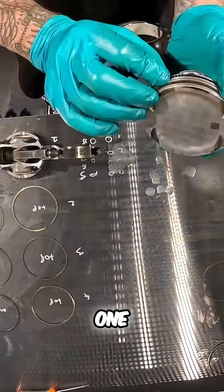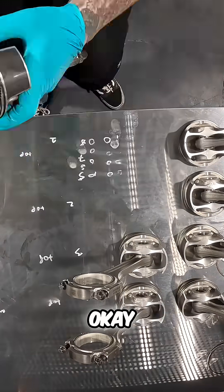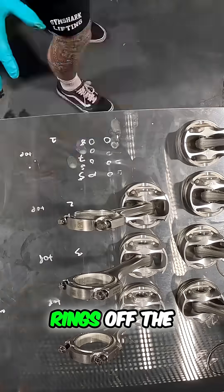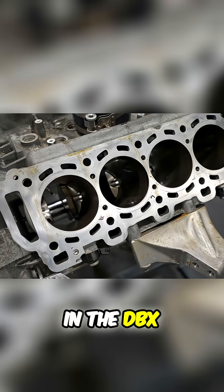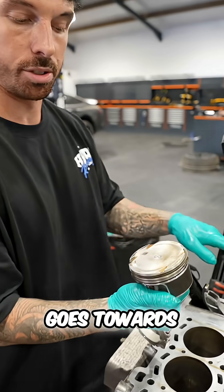On to the next one. The old pistons should be okay — they all measure to spec. So I'm transferring all of the old piston rings from the old pistons which were in the Mercedes block onto the pistons which were in the DBX block. Pistons are going in, and the arrow on the piston goes towards the front.